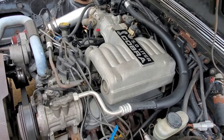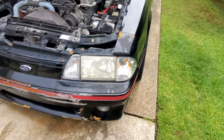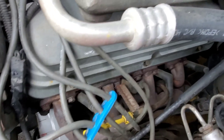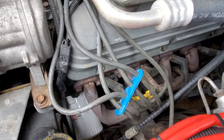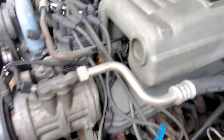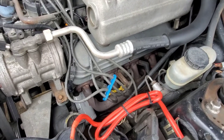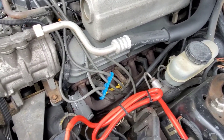Here's our '89 — this is our daily driver in case y'all have never seen it, it's just a beat up old raggedy GT. Over the past week I've developed a nice little tick, and at first I thought it was the roller lifters, but then I realized it wasn't based off RPM — it was based off engine load, which 100% screams you got an exhaust leak of some sort.